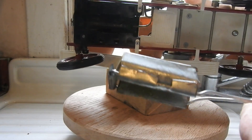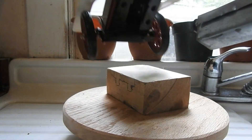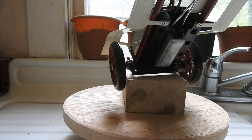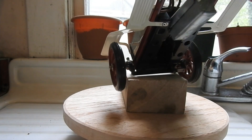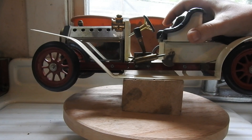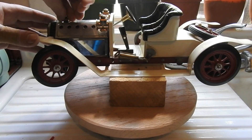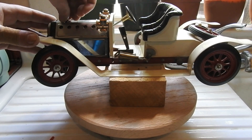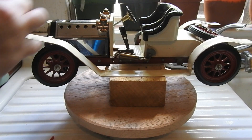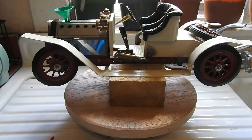My roadster was missing a fuel tray, so I bent some sheet metal and used a wire as a handle. It's not pretty but it's easy to insert and remove from underneath even while it's lit. The safety valve was so heavily corroded that I had to remove it with vice grips, which marred the knurling. I used some PB Blaster to remove the corrosion.